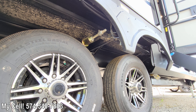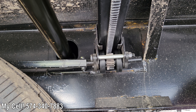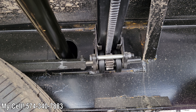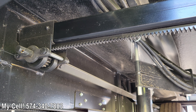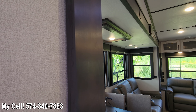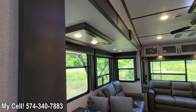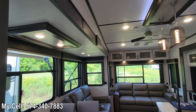Number three: the slide mechanism has completely changed. They've gone away from the pulley system with cables — a lot of you are going to be excited about that change to a rack and pinion. The benefit is you actually gain a couple of inches of space inside due to not having those pulleys and cables in the way. Now it's all in-frame, running on the tube and some gears.